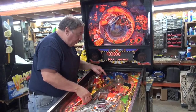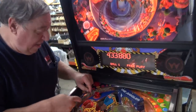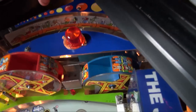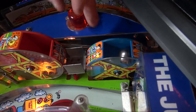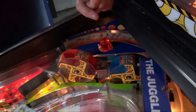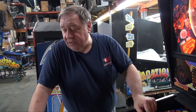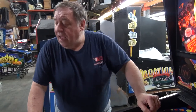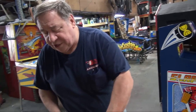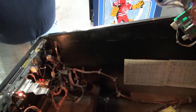Now, you know when your belt's bad, the old belt's black. Come over here, please. The new belt is clear. Steve Young at Pinball Resource has it. The ball gets that far and stops spinning, then you know your belt is slipping. It's time to order one from Steve. He's getting the cabinet just the way he sold in 2003. Now, he needs... Oh, I want to check one thing. Good. Yeah, it's the tilt bob in it. Just want to make sure.